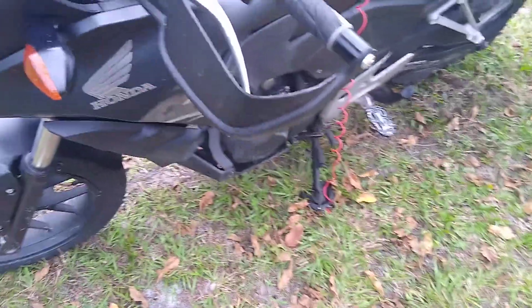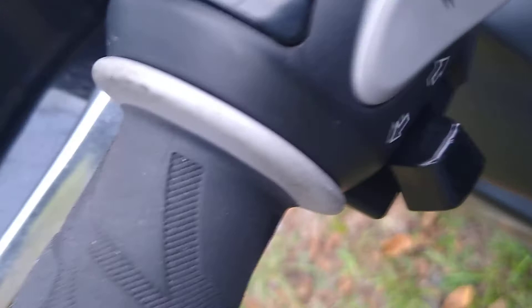Hey, just wanted to make a quick follow-up after my little crash the other day. No problem anywhere, really. The only thing — I got some mud in my turn signal switch, which I rinsed out with some contact cleaner, and that worked just fine. It was causing my left turn signal not to work correctly.